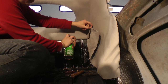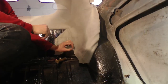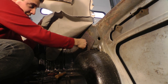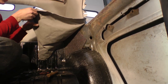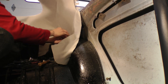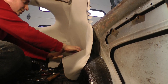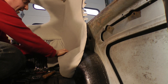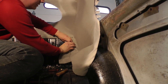I'm going to glue the firewall here too - get a little glue on that and let it set up. Once it's tacky, you want to glue the material just to the hump, not to the wall. A lot of people glue to the wall and that's not right - you're supposed to glue on the hump so you have a straight wall with the material. Feel around with your fingers to find where the hump is, then pull this down to the wheel hump and keep it straight up and down. Work your way back. If you start to wrinkle up a little bit, just pick it up and pull it tight.